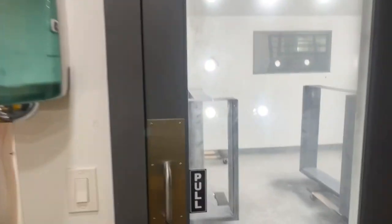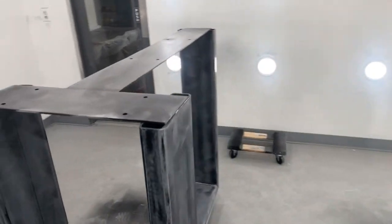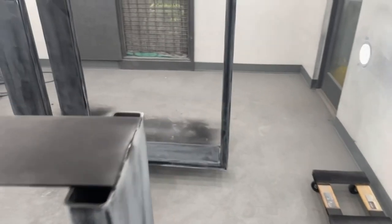I'll show you. I sanded it down real quick this morning with some 320 and then hit it with some Scotch-Brite pads. Then I wiped it down with some window cleaner, and then I tack ragged it off. So they're ready for clear. So we're gonna go ahead and throw two coats of clear on here.